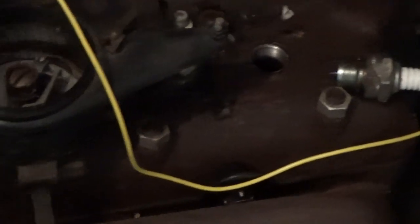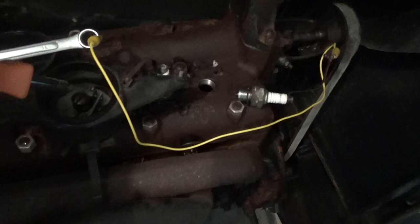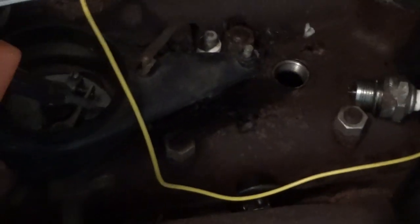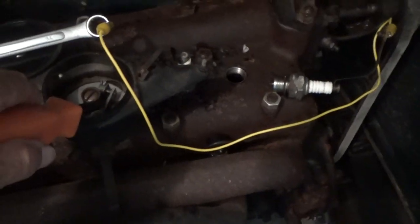So that's what I'm going to do now. I can't use the flashlight, but I can open these points with a screwdriver and you'll be able to see the edge of the plug spark. Okay, so now I'm on the points and getting ready to open them.